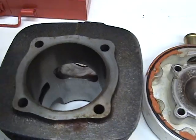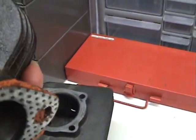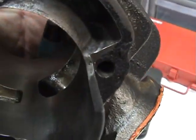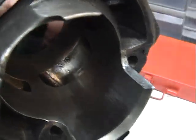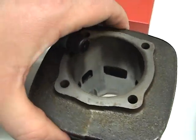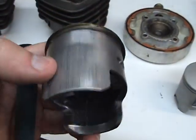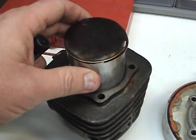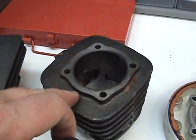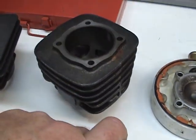If we look at the 54mm cylinder — it's got a polished intake right here. But if you look here you'll see seize marks going up the front of the cylinder towards the exhaust and above. And if we turn it around, I have seize marks going down. What that tells me — and this is the piston — is that the piston is not getting too hot, but this may be a slightly bigger piston, bored one size over. Or when this cylinder was made, it wasn't bored out completely to the right size — but I'll have to measure them to find out.